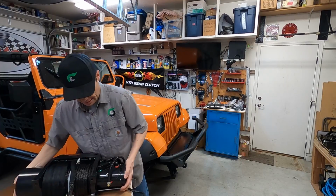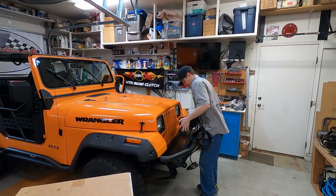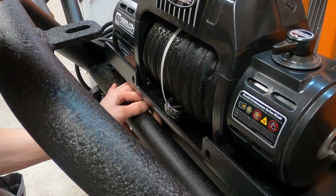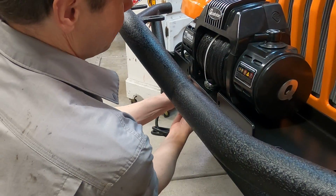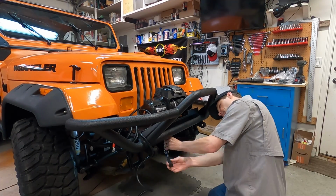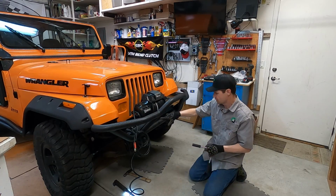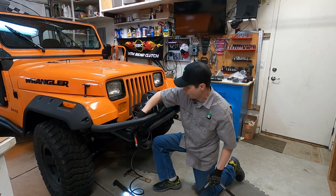Pretty slick. All right, let's lift this guy into place and line it up. And get all 4 bolts loosely installed before you start tightening anything down. Right, that winch is secure. These bottom mounting bolts, you're supposed to get up to 50 foot-pounds. It is secure now. Let's run our wiring up to our battery.